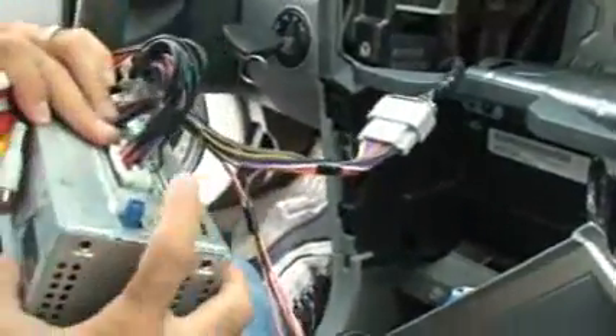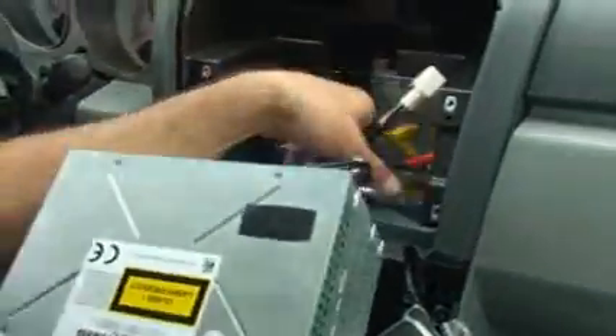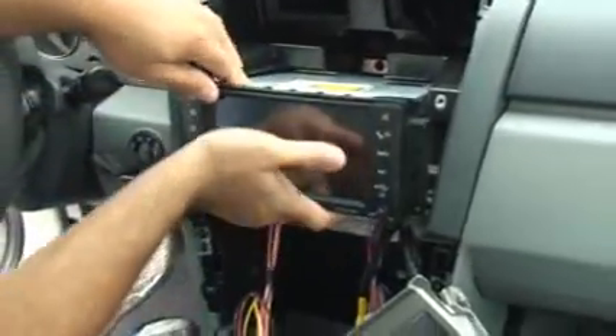When you install your radio, just connect the regular FM antenna, the satellite radio antenna, and the GPS. It fits back in the same DIN location as the original radio. Very simple — just takes a few minutes. Pop the panels back together on the car and you've upgraded to a MyGIG radio with lockpick, enabling all the functions in motion.